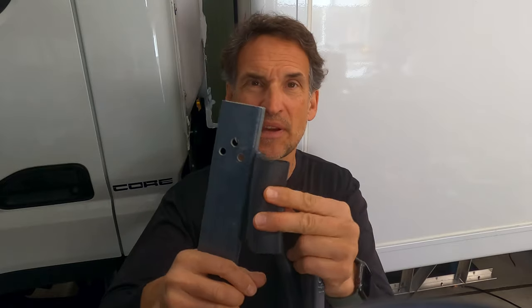I was playing with some different rubbers and seals, including a smaller boot and a very hard rubber which doesn't have much give when it goes this way — which I do need, because the cab is going to come forward and it's got to be able to compress. I was also worried about wear and tear over time as dust builds up between the two and this is going to be rubbing as it's driving down the road.